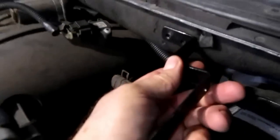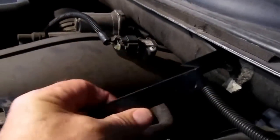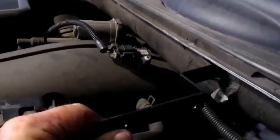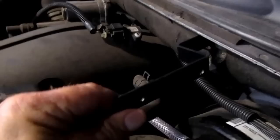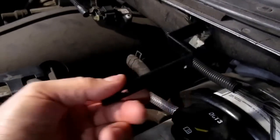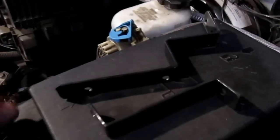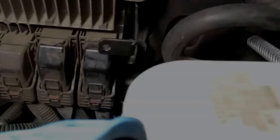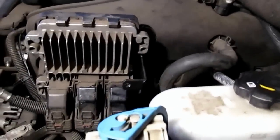This one is going to mount with a couple of self-tapping screws into the firewall, and that will hold the dryer filter. It's very light — it just weighs ounces — so I'm probably just going to use plastic ties. It's better to have it a little loose than too tight. You can make these brackets in your vice. For this 2008 Chevy it took just a few minutes to make them, and I threw a little black paint on them so they look nice. Mount them up — just a simple little bracket — and that'll hold the reservoir.